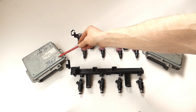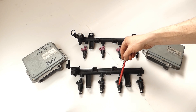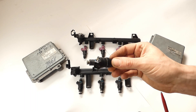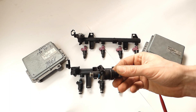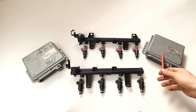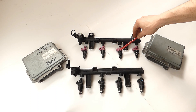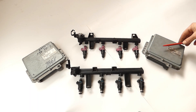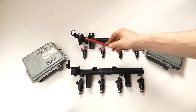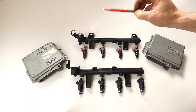Now for things that don't fit or are not compatible with each other: you cannot run the new ECU with the old injectors - it will not work. These injectors will not be controlled correctly and will not inject. The old injectors are from Sagem and they only fit the ECU of the XU7 JP4. The reverse is exactly the same: if you get the Bosch injectors and want to run them with the old ECU, that will not work either. So you must combine the 2L 16V ECU with the Bosch injectors - otherwise it will not run.